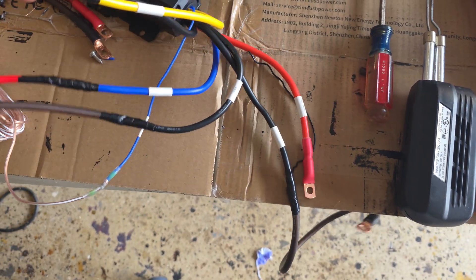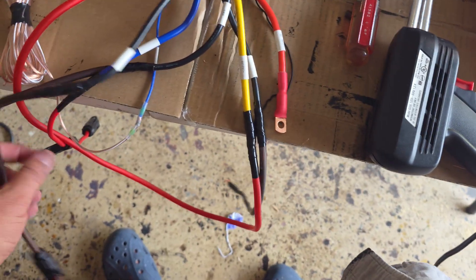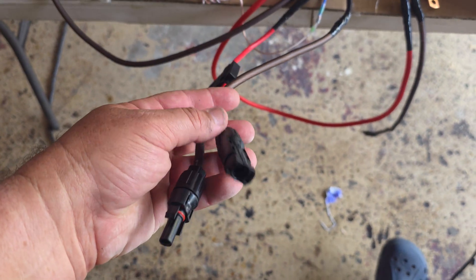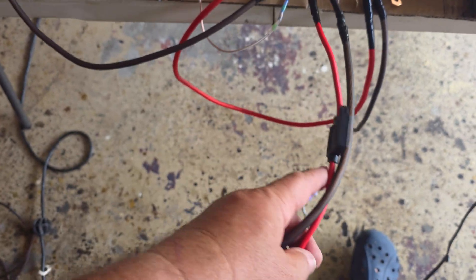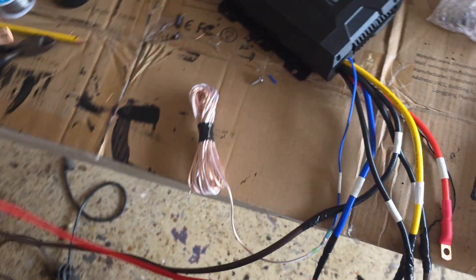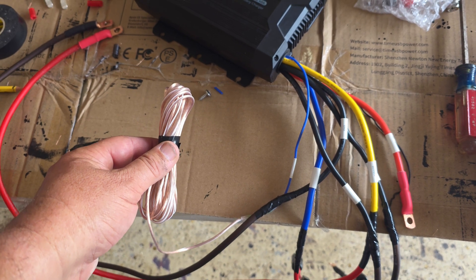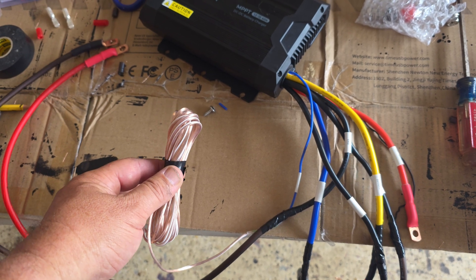For future use, I have also installed the solar plugs, because I plan on putting a 200 watt solar panel on top of the truck once I get my smart cap — if it ever comes. These are the leads that go to the battery to keep it charged. This takes the place of my isolator — basically connected to a keyed power source or accessory power source, so that it only charges when your engine is on and doesn't drain your starter battery.